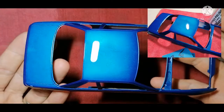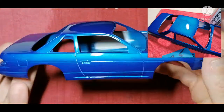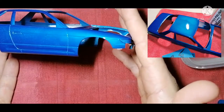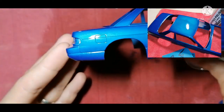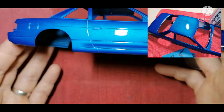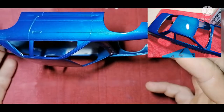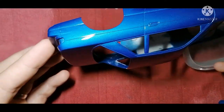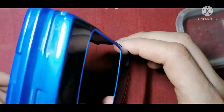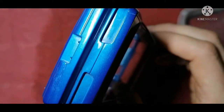If you remember from the start with all that orange peel, and then you look at this — the difference a wet sand and polish makes is just huge. This is proof of why it's my favorite part. It makes it look so much better, gives such a nice finish, and helps make the paint come to life. You can see the metallic fleck and the difference between the dark and lighter shades of blue really comes out now the bodywork's been polished up. Thank you so much for watching — I hope this helps and inspires you. Take care, see you next time.